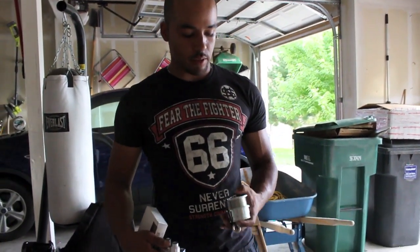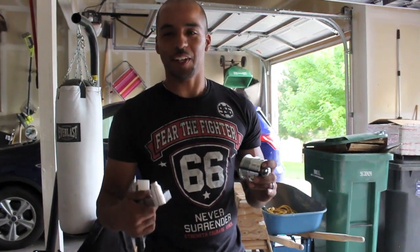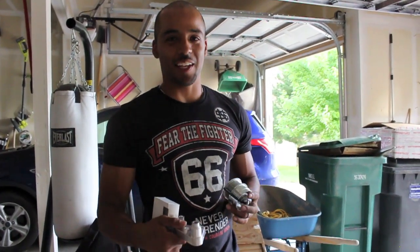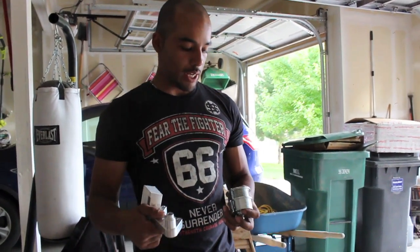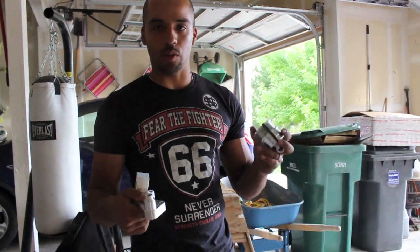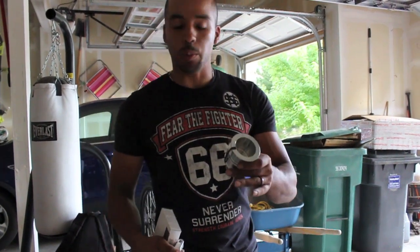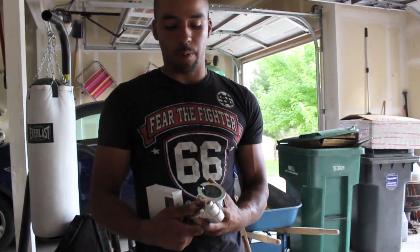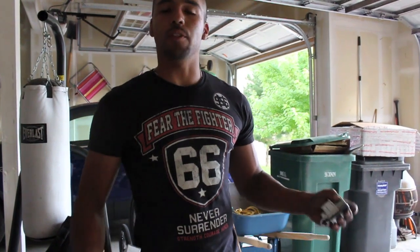What I have to do next is install my pulley setup. This is an Olsen's Custom LSA swap kit that is specific for the GTO. The guy's name is Jesse — he sent me this and also sends a write-up on how to install all of these. Here's the pulley to run with your stock accessories, your idler and the idler wheel, and it will allow the CTS-V charger to run off your stock accessories on the GTO. I got this off eBay — they're very cheap, about $15.